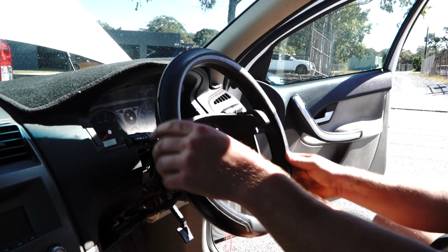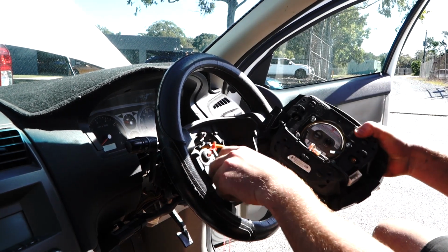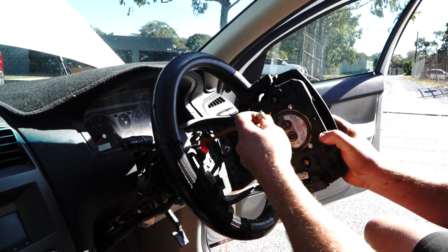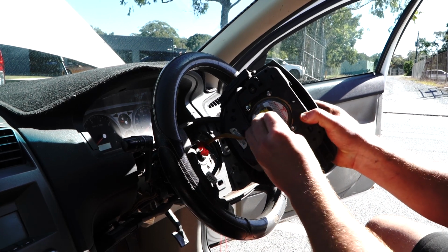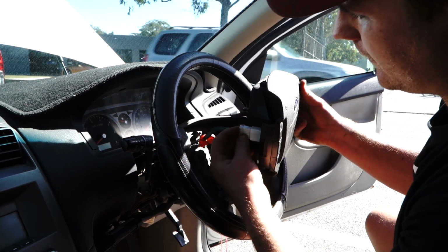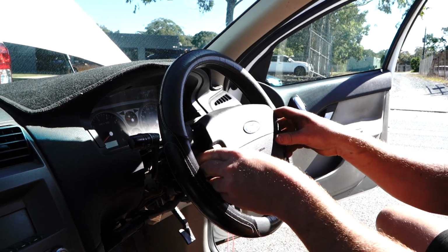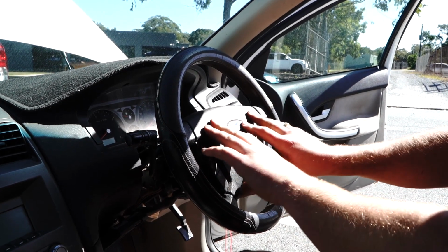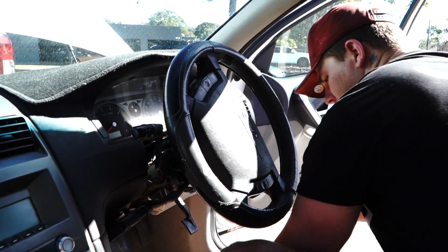Of course, at this point guys, it's now time to bring your horn pad back. Nothing hard here guys, the whole thing's, as you can now see, fairly straightforward. Color match the colors, 1, 2, and then of course the little white plug plugs in like so. Horn pad back in, and as you guys already realized, Torx bits, tighten them up, and you're good to go.